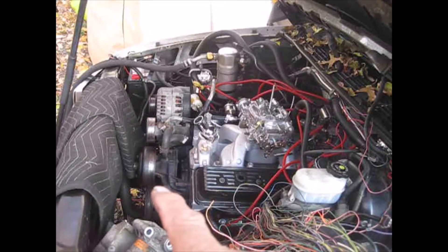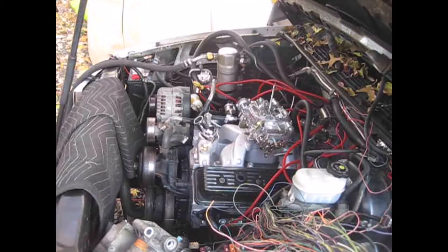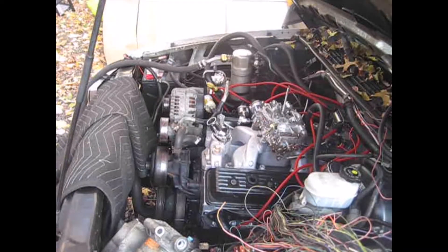I am now in the process of putting the alternator on because I got another hot wire that needs to go on with the alternator — the white wire — remember it goes to the 12 volts here. So we're going to put that on and then we're going to crank it to start.